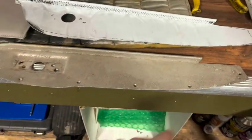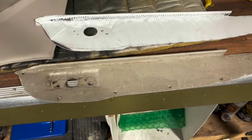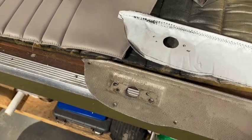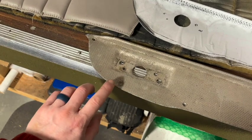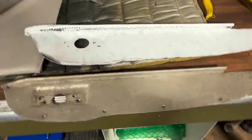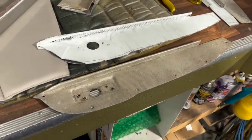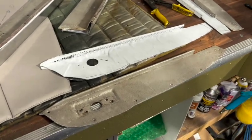I'm going to be drilling all new holes because the body shop filled in all my old holes — some were larger than others and it was easier to fill them in and start fresh, and they actually filled them with weld, not just filler. Because it's weld it's a lot harder than the original steel, so I'm going to drill new holes right beside where the old ones were — just an eighth of an inch apart and they should go through no problem, getting a nice bite. The screws for these are unique — very tiny and very fragile. You've got to get a nice hole drilled; anything too tight or at an angle and those screws will just snap.